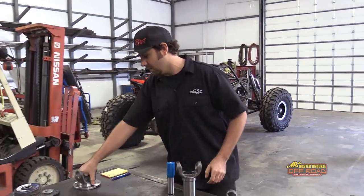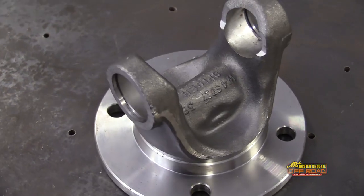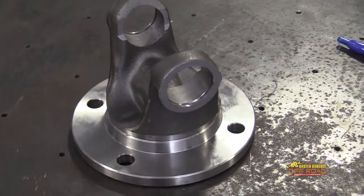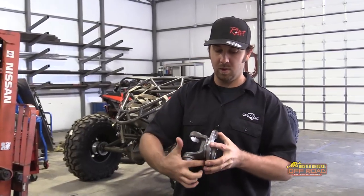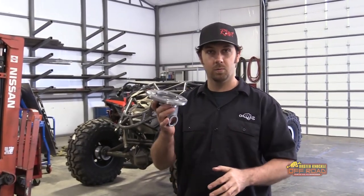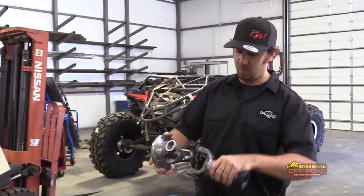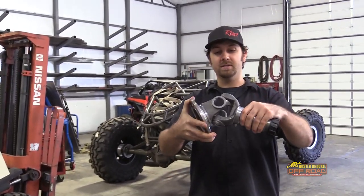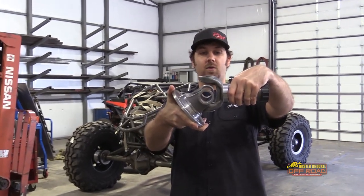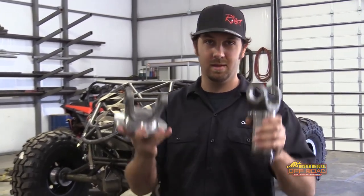Here we have the optional 1480 dry flange kit — a machine plate with the pattern for a Rockwell. The yoke itself is another forged 1480 unit. We're going to TIG weld this all the way around the outside and all the way around the inside, running these front and rear. The cool thing is when they're all the way together you can see how much turn that thing has — about 45 degrees when it's all the way turned. If you have a drive shaft angle problem, here's your solution.